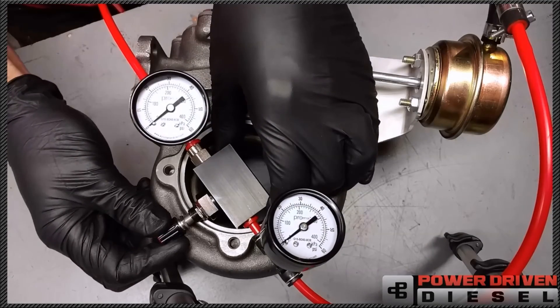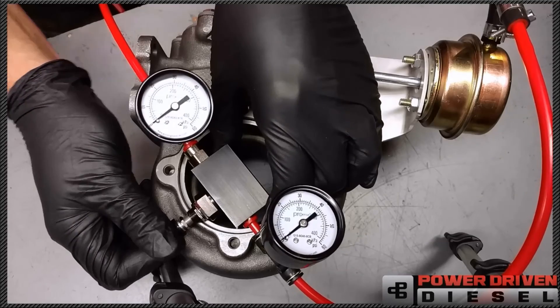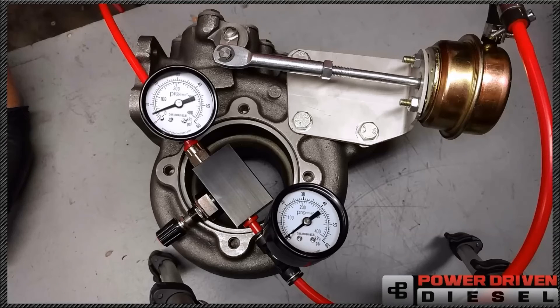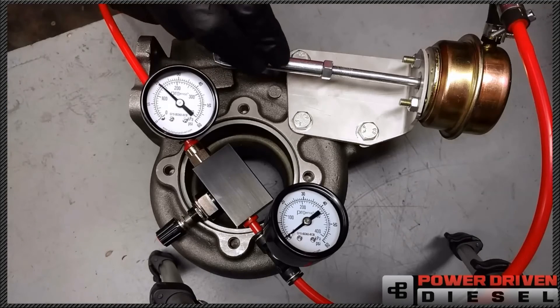I want some more — that was a little bit too lazy for me. I want the wastegate closed a little bit longer, so I made a few more turns. Let's see what we get. Now up to 10 psi — nothing. 15 psi — still no pressure through. 20 psi — still no pressure through. This thing is still as tight as if there was no pressure at all. It doesn't even know there's any pressure here.